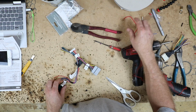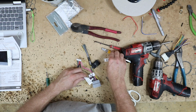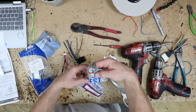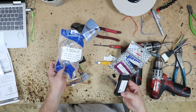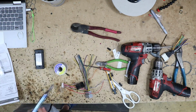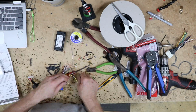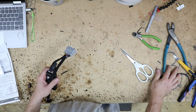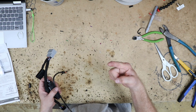Now what we want to do is get our harness for the radio all set and ready to go so that we can test it. For this, I forgot to mention, we're using the BHO 1818 from Best Kits, as well as the LCCH11 from Pac, which is the same company. So our harness is all set and ready to go. We have our antenna adapter. Now all we have to do is get the kit made up on the radio and finish soldering the wires in the dash.